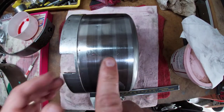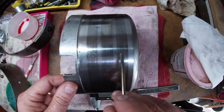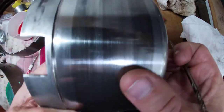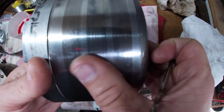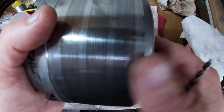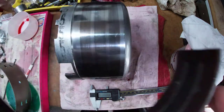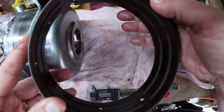Take notice of these three marks right here — this is where the band is riding. Make sure it's not grooved or damaged on those physical surfaces, because that would be a bad thing. You're probably not going to be able to smooth that out. Looking for any fingernail-depth grooves, as that would make the drum too thin and your band won't apply properly. This is the factory band that we took out of our existing unit.